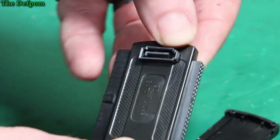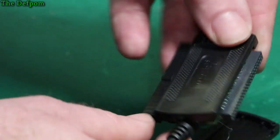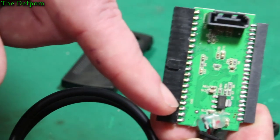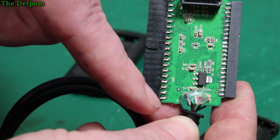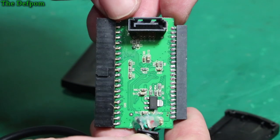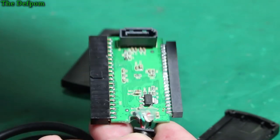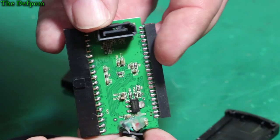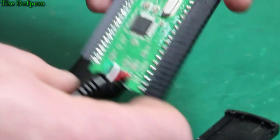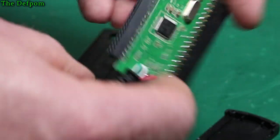You can see it's a close fit on there, but that doesn't want to fit. Okay, let's look at these connections down the side instead. So you can see this is very slightly offset downwards - very slightly that way but not much. And the other connector - I think the other one's in the centre. This end makes it look like it's up that way, but the middle ones look like the centre and the bottom ones look like the centre. So it might just be the way the soldering is. Yeah, I think it's just about the solder blob. This one here is slightly down, so maybe that's part of the problem.